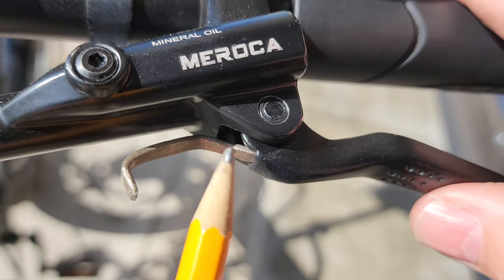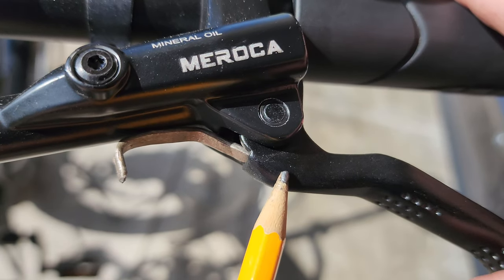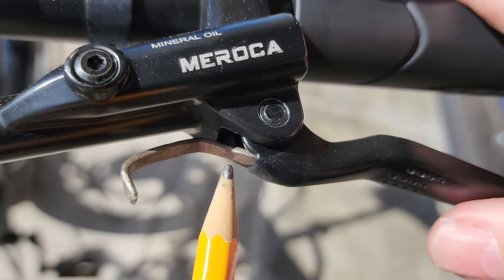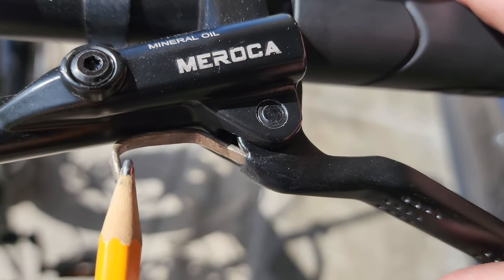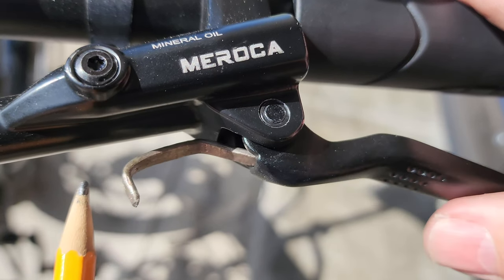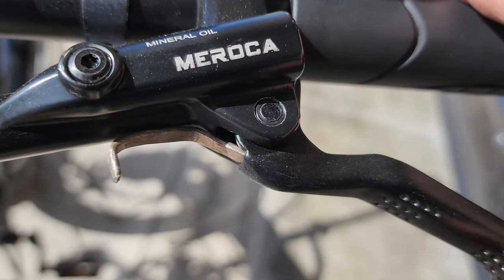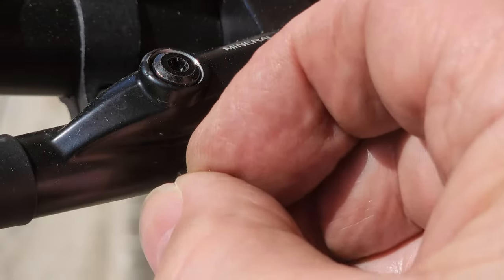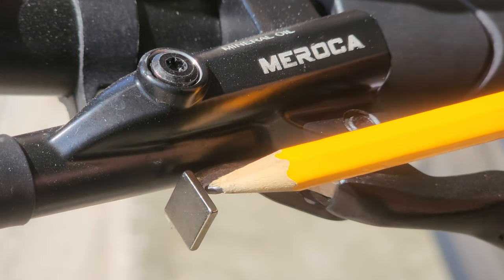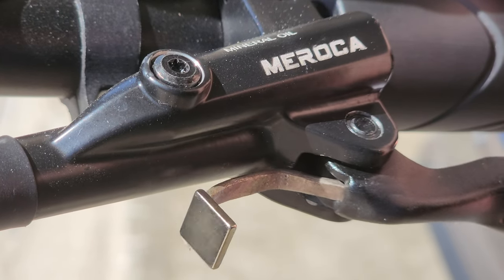Flat rod, I hammered it out from a piece of scrap stock that I had in my toolbox. Made the bends. It goes into the lever here around this pivot, which kind of holds it in place. It's got the bend to follow the contour of the master cylinder, and right here it has a flip out, and that flip out is where the magnet's going to go, and that gives you enough travel to trip the switch. This little magnet's going to go right on there, just like that. So this magnet will stick to that little bracket and move just like that.